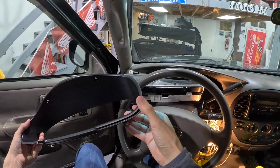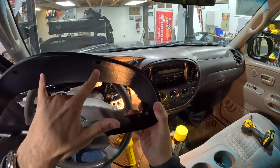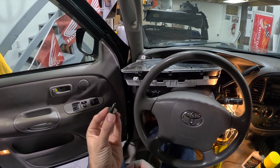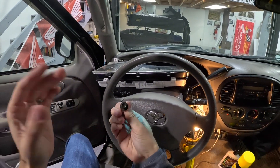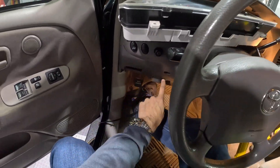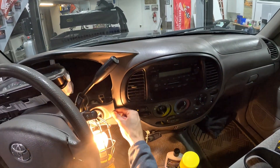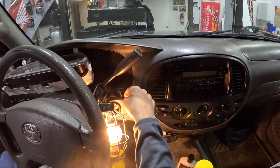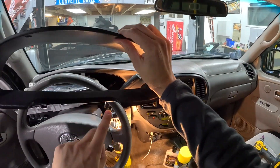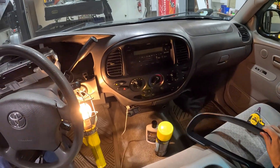This is kind of an interesting note. This clips into the dash. It's got two screws in it — you got to pull those two Phillips head screws. You also need to remove four 10-millimeter bolts, in traditional Toyota fashion, four 10s. One's down here on the corner by the fuse panel, there's one right there, one right there, and then one down in the other corner. That allows you to pop this piece of trim loose, which this dash trim slots into. Otherwise you're not really able to work it out, so you do have to just drop that, just pop it loose — you don't even take it all the way off.